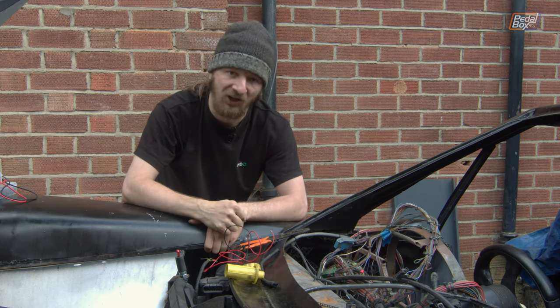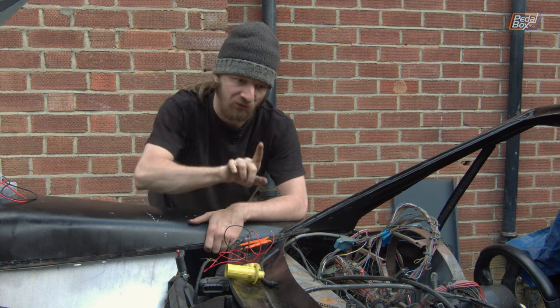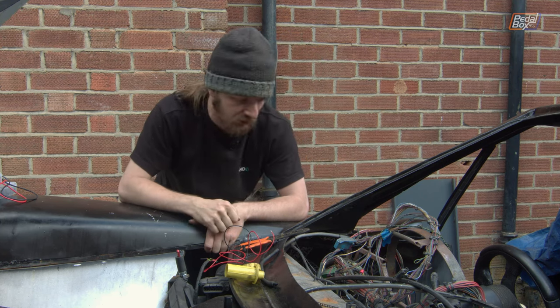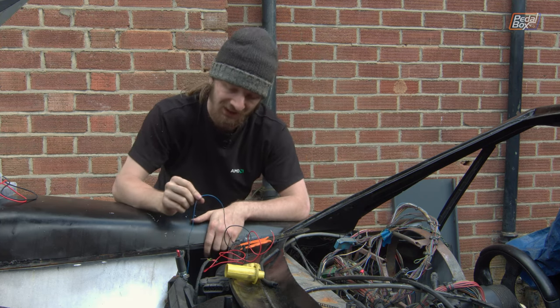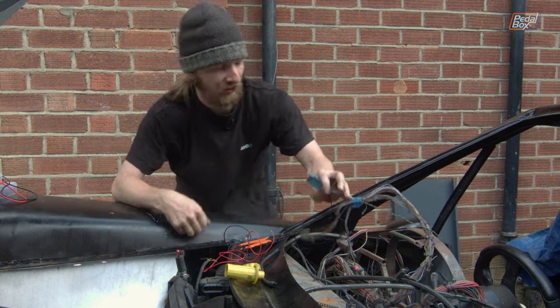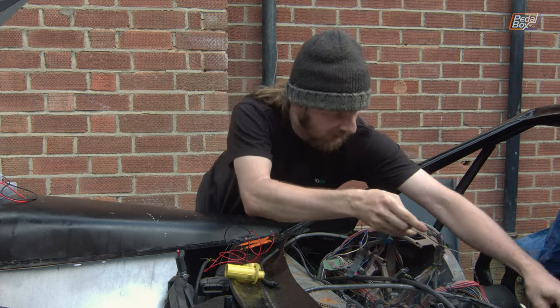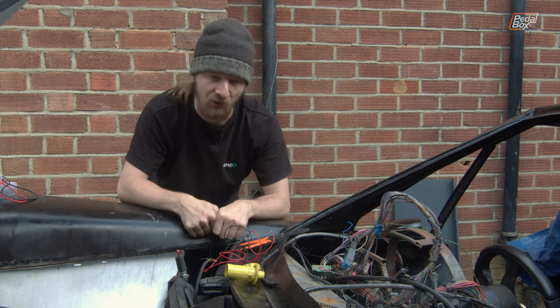That's because we've already taped it up and everything, and we don't really want to break into that. It'll probably look worse if we've got like this random extra wire running next to it. So we're just going to shortcut it through here. It's a much shorter run. And in fairness, the fact that we could only find a few feet of this blue cable with a brown stripe may have been a factor as well. So that's now done. I can tuck all of these back down inside the instrument cluster. Well, I can if I take a few more seconds about it. Get that all away, and I think we're done.